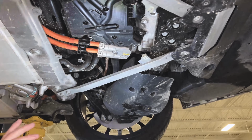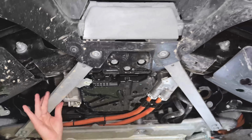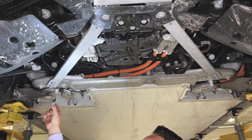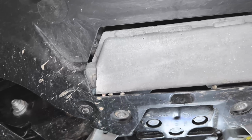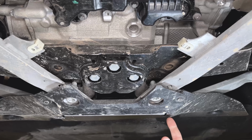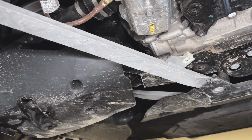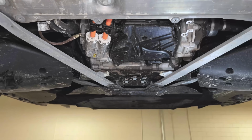But the interesting thing on this cradle application is the additional, I'll call it tier of structure. So you see these braces going to all 4 of the cradle mounting points. There's a brace extending from the forward mount on the rear cradle. It goes to a center point. In that center point, I think, it might be a casting. It's hard to see from the top, but, oh no, it's a stamping right here. So it's a MIG welded stamping. So they're going to this sort of nexus at the center. And then you've got additional pencil braces that are running cross car and connecting the 2 rear cradle points. We've seen that on other BMWs, but the interesting thing on this one is how low this X member or reinforcement is relative to the vehicle.